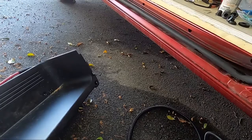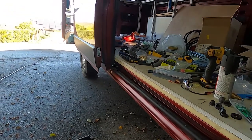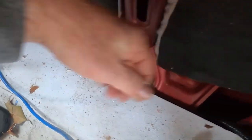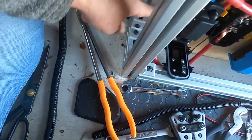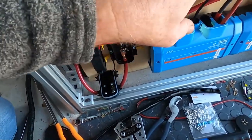I'm going to run it back, run it up through another hole, and then back to the alternator charger back there. This is where it came up — this is the wheel well here. There are three cavities here that had covers on them. If you reach down in here and back this way there's a slot, and there's one over here as well, that you can reach into as the wire is being pushed up and direct it to come out this way. So I got it coming up through here, down through here, and right up into this — this is the power feed for my alternator charger.